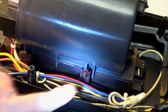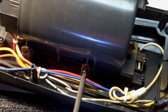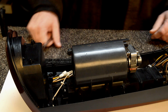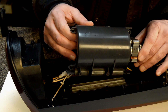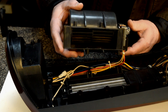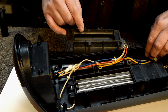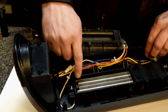We'll leave that alone. For now, I'm going to take this screw out and the other side. I have my screws out for my blower and I got it cleaned up a little bit. That pulls right off there, and of course you're still attached by the wires, so just take it easy. At this point you may see some dust and burnt hair or something like that — just get your brush on your vacuum and clean it all up. You can see there's a little bit right there.